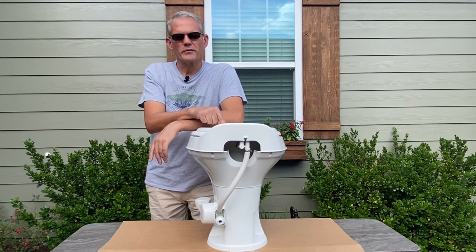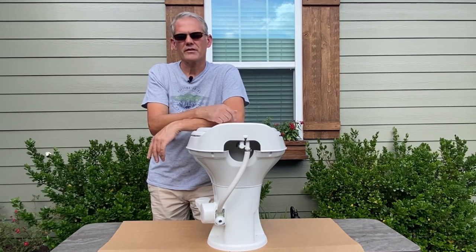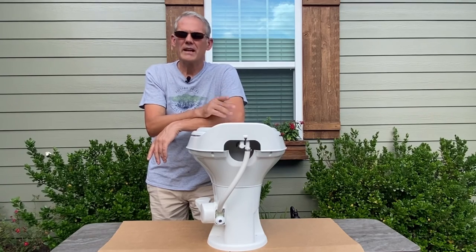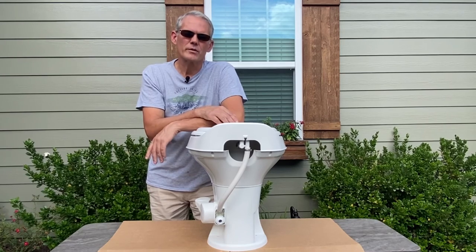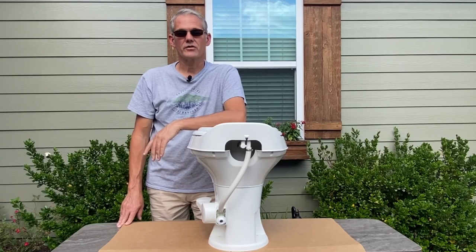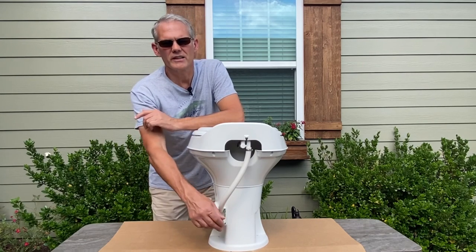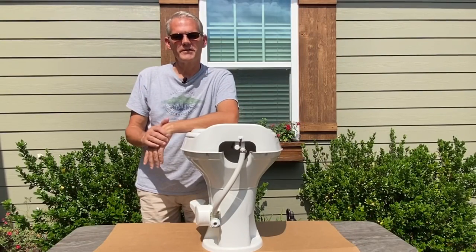Here is the old one, fully cleaned. In an earlier video we talked about maintaining your water system and mentioned you may need to clean the filter if you have low water pressure. At the time it was difficult to show the location of this filter because it was installed, but just know that it's right here. Luckily Linda and I haven't had any issues, but if you find yourself with low pressure coming out of the commode, you may want to disconnect the water line and clean out the area to see if this resolves the issue.